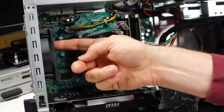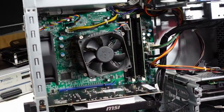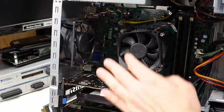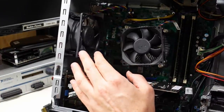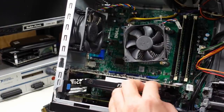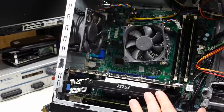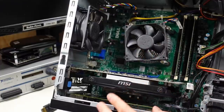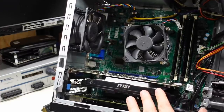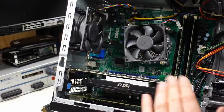There's also a four-pin case fan on the back for chassis cooling — looking at the fan blade profile, that's blowing out. If they're noisy I can always order Noctua fans to replace them, but I have a feeling they'll be pretty quiet. The video card might be a little noisy — these older MSI cards use quite a bit of power, although now that I look at it there isn't even a power connector on this card, so it can't be particularly powerful. Hopefully this thing has hardware MPEG encode, which I absolutely need for video capture to work properly.